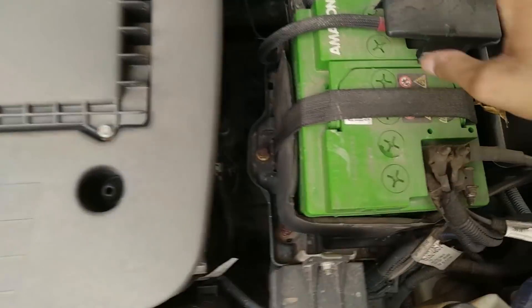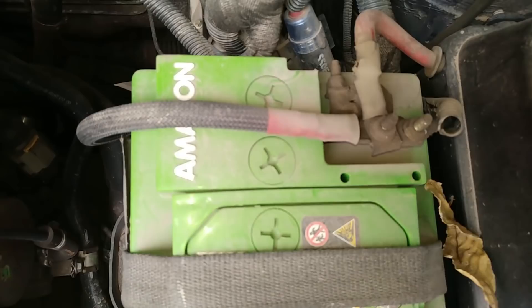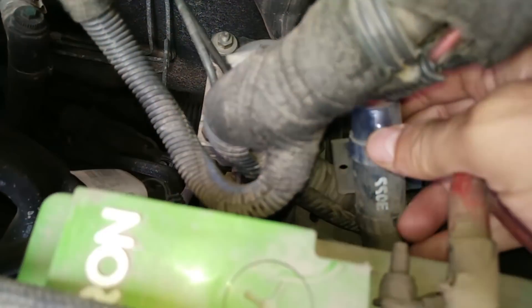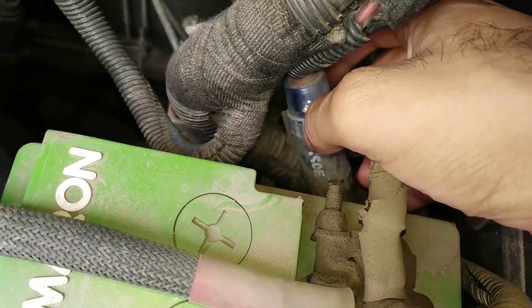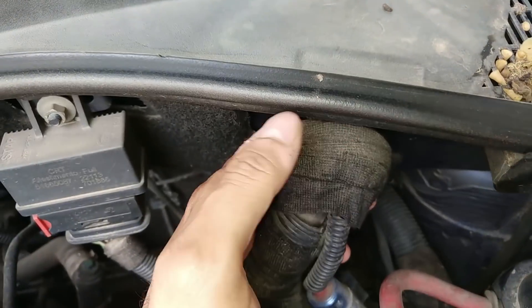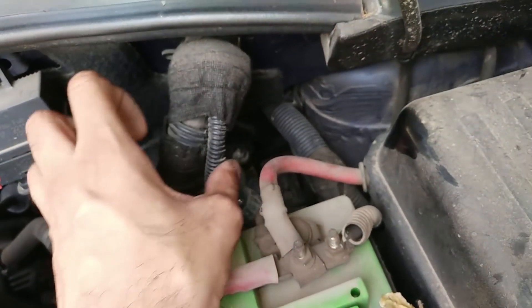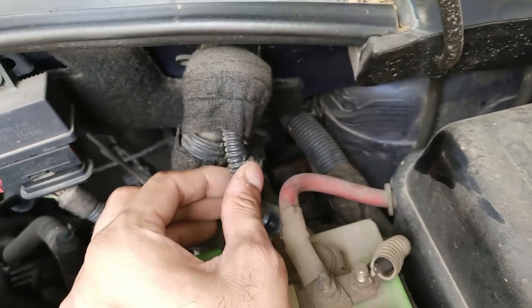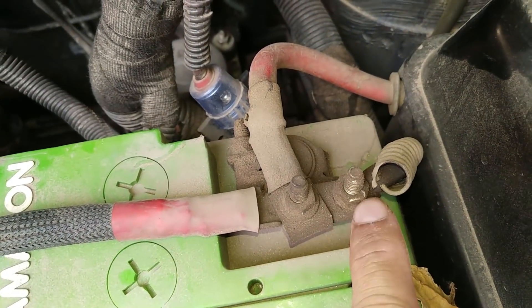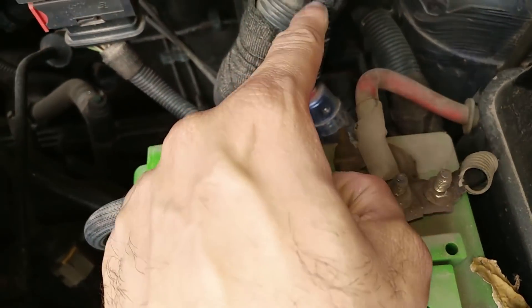Connect that wire to the positive side of the terminal of the battery, and always you have to attach a fuse with our wiring kit. So we have to find out how to take the cable into the cabin. I remember that this is our coupler here — I put this wire through. One end is connected here, just like this. I used a ring terminal and put it inside.